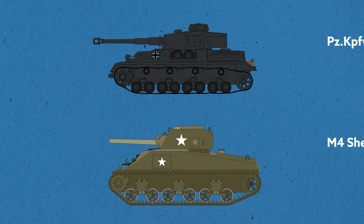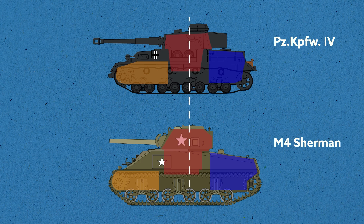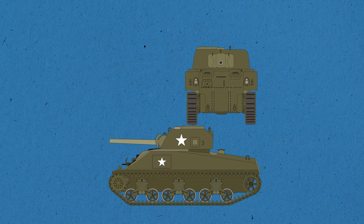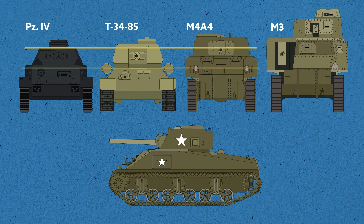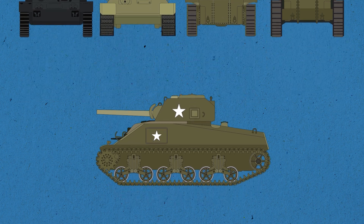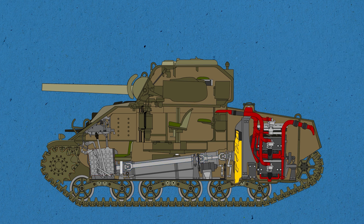From a technical point of view, the Sherman's layout was typical for American and German tanks of that time, with the engine compartment located at the rear and the transmission at the front of the tank. The fighting compartment was situated between them. The fully rotating turret was installed almost in the center of the tank. One of the most distinctive features of the M4 was its height, taller than that of any comparable tank except its predecessor M3 Lee. It was high due to the vertical arrangement of the radial aircraft engine used on this tank and the front-mounted transmission, which necessitated a tall casing for the drive shafts from the engine to the gearbox. This made the tank more challenging to camouflage and presented a larger target on the battlefield.